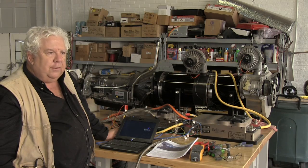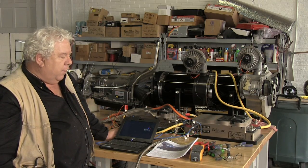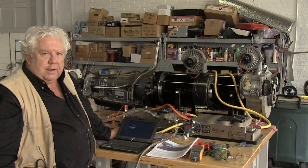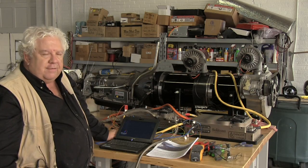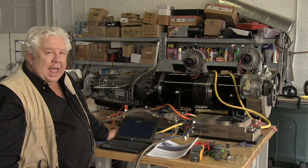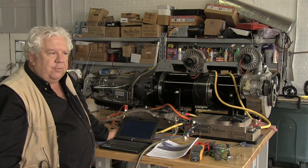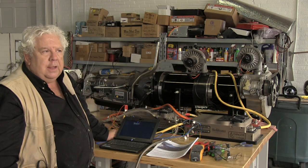The batteries can only store the equivalent of about 3/4 of a gallon of gasoline right now in energy. So they're not a great way of doing it, but they're much better than they were. We have crossed a threshold of viability, making the car possible. And the drivetrain itself, the electric motor, which is 100 years old, is realistically 7 to 8 times more efficient at converting energy into forward motion than an internal combustion engine, and always was. So when we look to the future with constrained sources of energy, the ability to use the same energy but get 8 times more work out of it by switching our technology a little bit is enormously attractive.